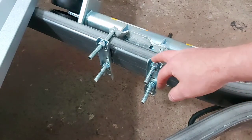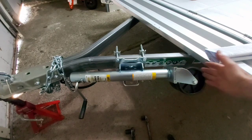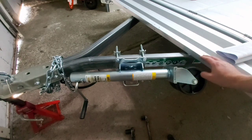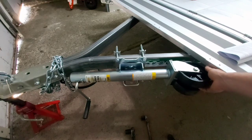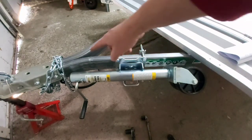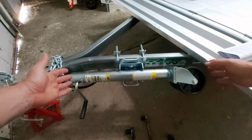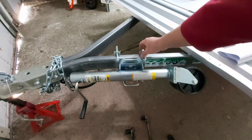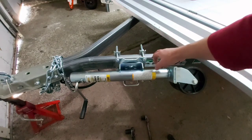Let's take a look at the back of the mounting. This is where you've got to determine how far back you want your jack in the storage position. You don't want to have it too far towards the back of the trailer where it's going to interfere with the tailgate when it's down. As you can see, I probably have about a quarter of an inch clearance, and I have about half an inch of room at the front. I put white lithium grease where metal is on metal, since over time it will wear and start rusting even though this is galvanized.